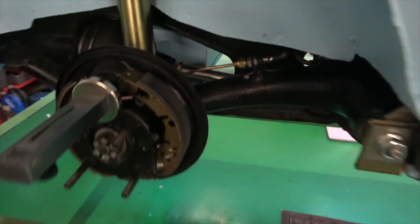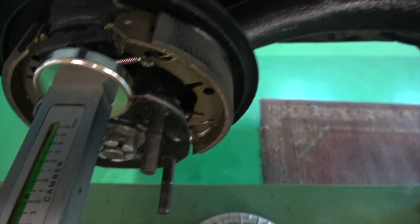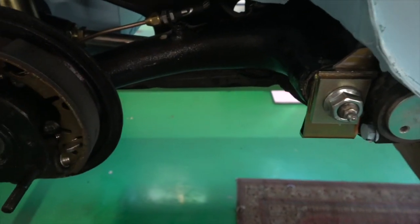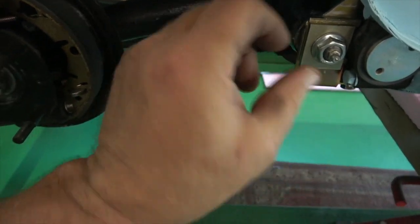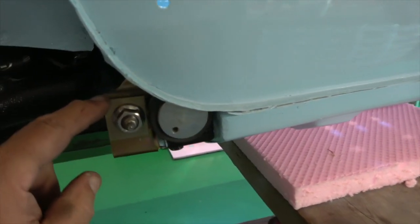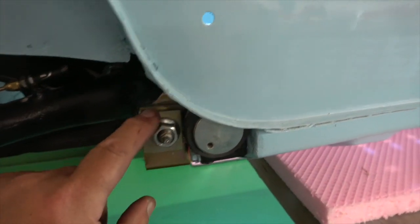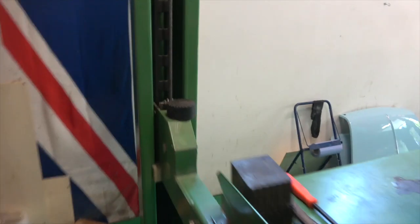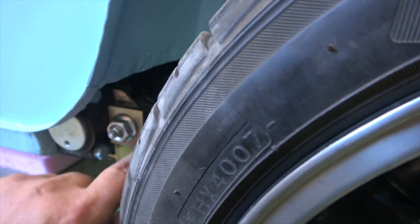When we put it down I'm sure it'll look even slightly more negative. We've set them both up — this is the camber gauge and you can see that's one and a half degrees of camber. You can also adjust the toe because there's such a big hole behind these, as I showed earlier. On this one you can see there are two grooves left, but it's correct at one and a half degrees camber. On the other side there aren't any grooves left — it's almost flush.